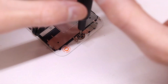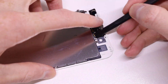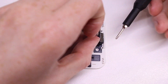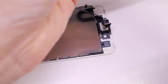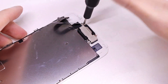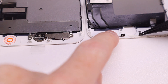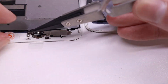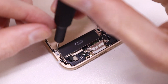For this phone I'm actually using a refurbished display, which means this screen is a used panel that's previously been cracked and then had its glass replaced. This is the best way to get an Apple screen on the cheap, and it also means you're going to get the best possible touch, 3D touch, and colours in the display. There are even companies out there that will buy your old cracked displays just to refurbish and sell on. Now I'll need to transfer across these little water seals from the screw standoffs that hold down the display to the phone, which will just stop any water or dust from getting into the device.